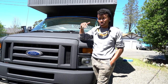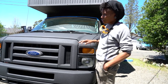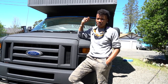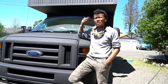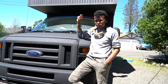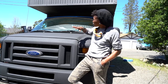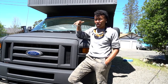After I went through and sanded the entire vehicle, I had to prime all the metal. I worked with another product also made by U-Pol — it was an epoxy primer. They have an etching primer but I didn't go with that one; I went with just the straight epoxy primer, and I primed all of the metal surfaces to help with paint adhesion when I went through to paint with my actual top coat.